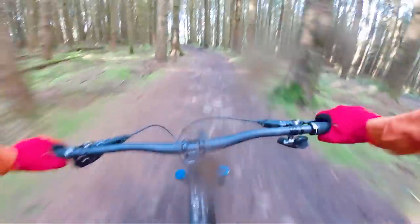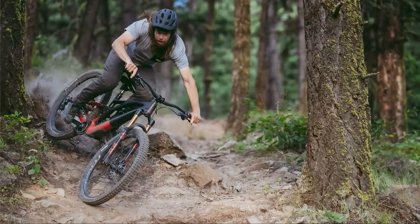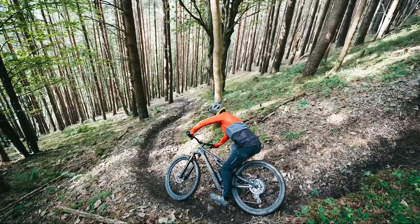The bike's frame is packed with features, but that's not where it stops. The suspension has also been tuned for the new frame. Even though it's only got 150mm of rear travel, Specialized claims the new Stumpjumper Evo has been tuned to have an impressively progressive suspension curve. That means when the suspension's at the start of its travel it's nice and supple, and then as it compresses through the bike's travel it gets harder and harder as it resists bottom out. The leverage rate is relatively linear — it doesn't suddenly ramp up, it gets predictably harder as the bike goes through its travel. The bike's axle path has been tuned to have a small portion of rearward movement, meaning the back wheel is able to move out of the way of speed-sapping square-edged hits.